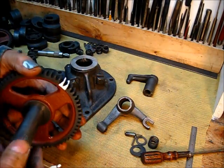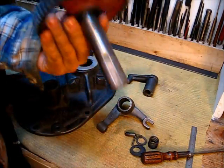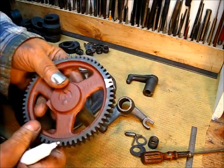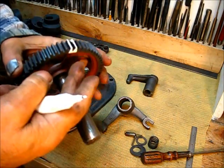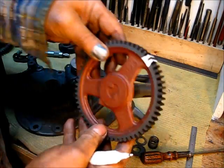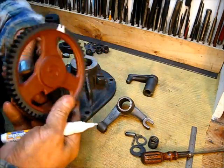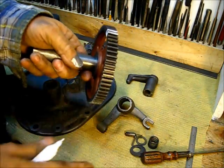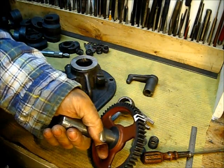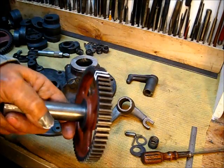If I marked the back side of this gear and I was using it in an engine that uses an EK mag, you can't see the back side — you see the front side. But if you're putting this gear in an igniter-type engine, you can actually see this from the magneto hole and get a feel for where the timing is at.